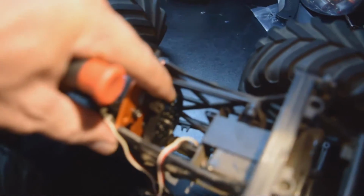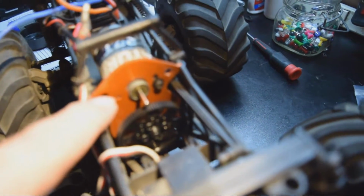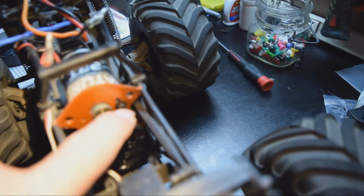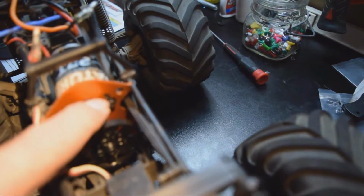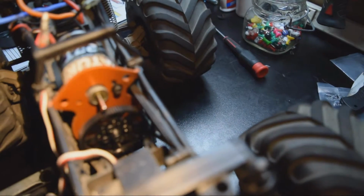First, before we can take out the screws to take the motor off to replace it, we have to remove the pinion gear by the little screw right where my screwdriver is. One quick note here on the motor: I got one screw out, but look at the other screw on the right side. When you put the motor back on, you want to make sure the screw is back in that position, so take note of where that screw is on the sliding bracket. It'll save you a lot of headache when you put the motor back in.